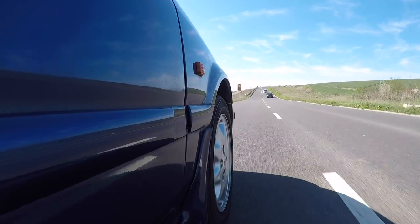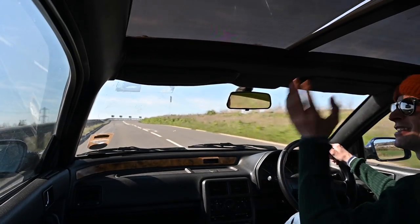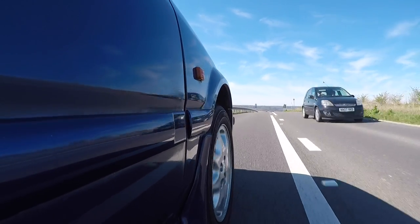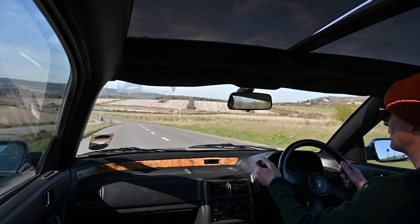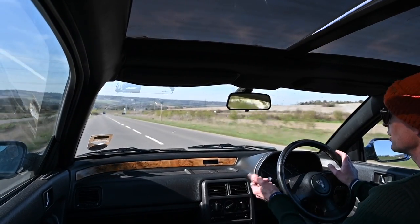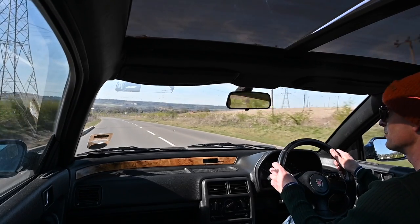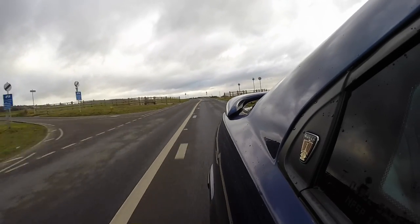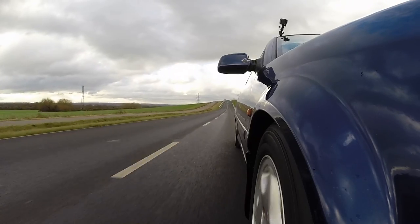Rover's reputation for quality has been unfairly tarnished, because cars like this really are very well made. This is pushing 30 years old, and okay the seat is starting to creak a bit and some interior cardboard fittings aren't great anymore, but the car still drives beautifully. Things like the indicator stalks still have lovely firm clicks and feel great in the hand — no wobble or vibration. The switchgear feels nice too. The thing that does fail frequently is the blower resistor on the fan, but you can change that for about four pounds by reaching behind the dashboard. The most desirable of these cars are the fully-loaded, even air-conditioned batch of 1995 cars that weren't registered until 1998 — known as the FDHs, because a batch sent to Japan didn't comply with changed regulations, came back, and were all given number plates ending in FDH. If you find one of those, they are the holy grail of the Rover Tomcat.